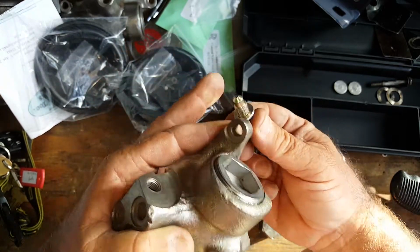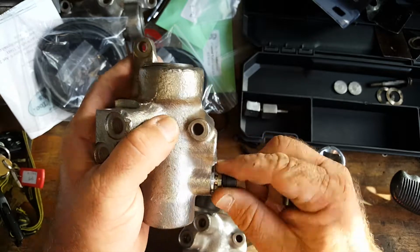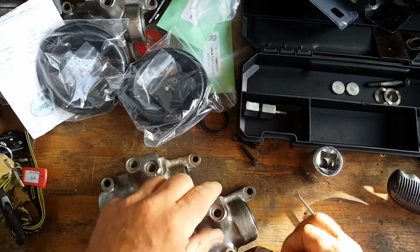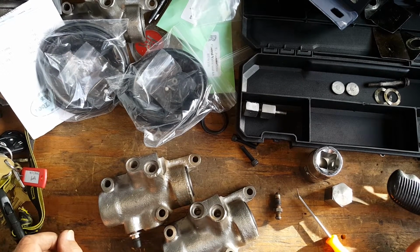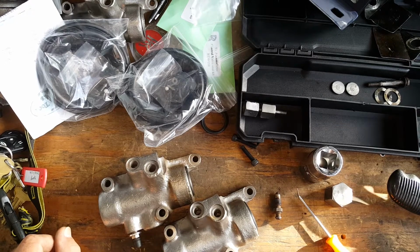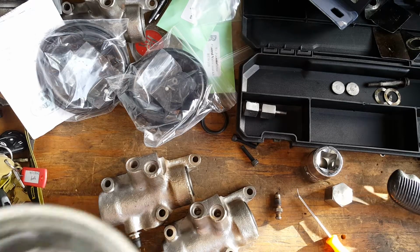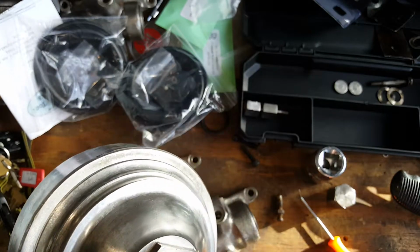So we'll send these back to the customer. They can use them both. You have the little ring here that tightens it up around the side. And there it is, Mr. Sunshine, Rolls-Royce mechanic Eddy. We just finished up two brake valves. We're actually going to stick them on the accumulators. These are actually the accumulators right here. They've already been charged to 1200 psi of nitrogen.